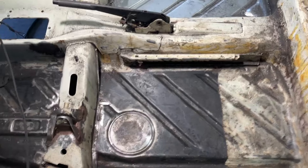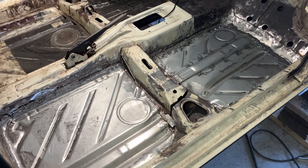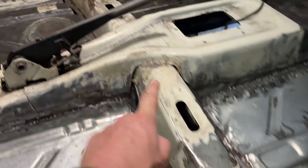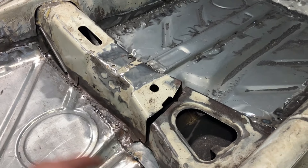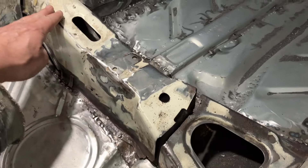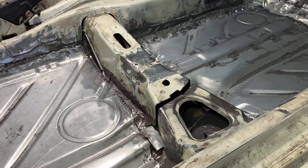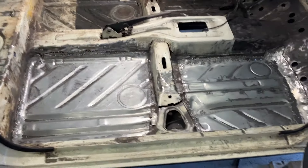I should be out here cutting out this driver-side seat rail and patching in those rust holes. But instead I decided to have some fun and delete the tripod seat mount. I'm planning on running a two-by-two cut square tubing, cut just enough to make this flush. That's going to close this gap and give us a flat mountable surface for our Mitsubishi Lancer seats — or some other conventional human seats, not alien German three-legged seats.